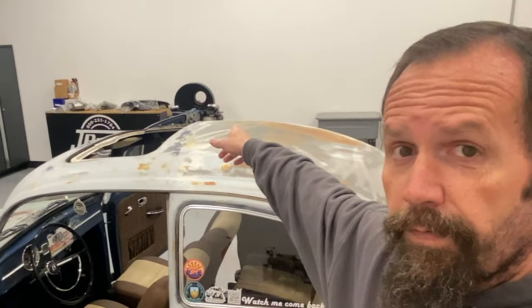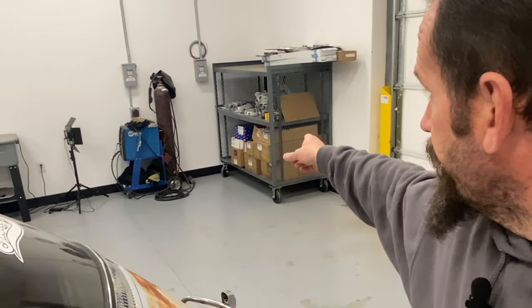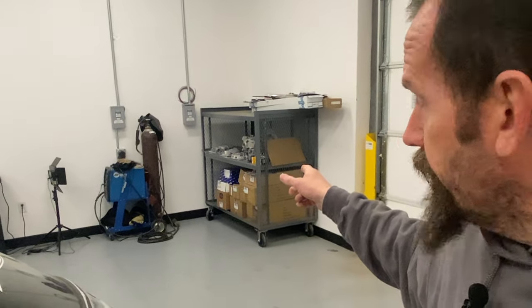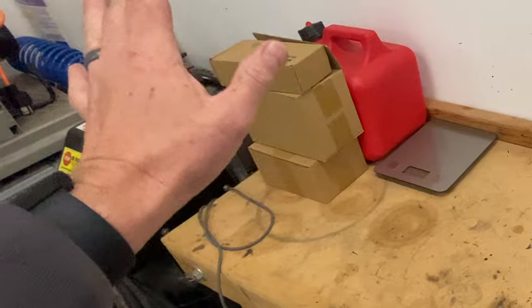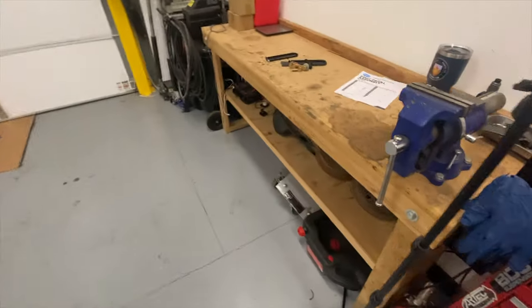We still have the unassembled long block that we need to finish turning into a running engine. We've got that damaged aluminum engine case and a whole bunch of products: 84mm flange crankshaft, 92mm thick wall pistons and cylinders — strokers. An 84x92 combination is going to be a 2234cc engine. We've also got a gram scale, ring grinder, flap wheels so we can end-weight our connecting rods and match-weight our pistons.